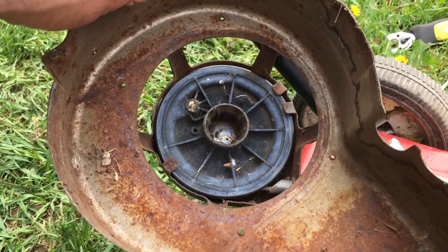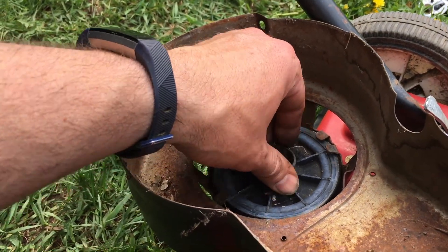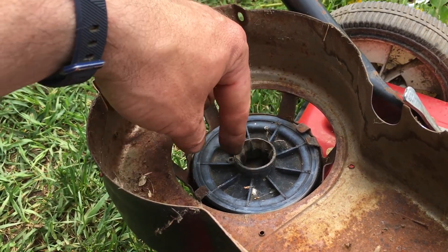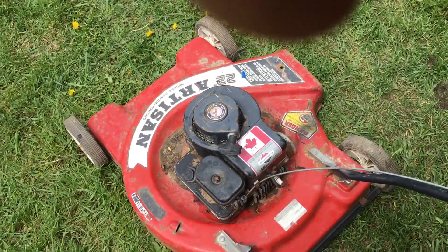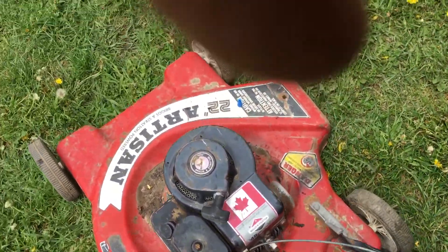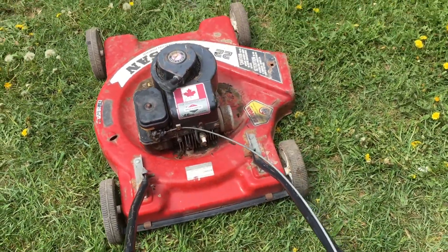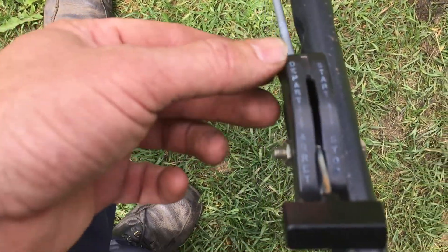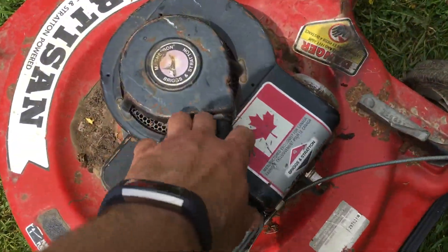It's just folded tabs that kind of go along for the ride. If it does get slow to recoil, you can kind of tighten the spring. Back together again - got the air breather on it now. I forgot the little cap there. Added a little bit of Lucas lubricant to the motor case - maybe that'll help slow up some oil consumption. It's got French and English labeling - this is the start side, full throttle. Our recoil should be fantastic now.